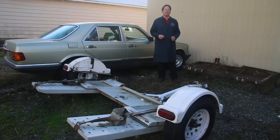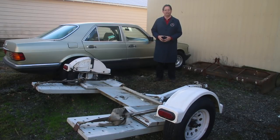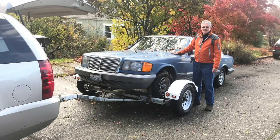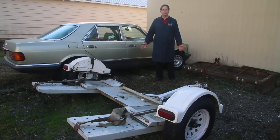Number one — and Mercedes recommends this, you'll actually find it in some of the manuals for these older cars — you are not supposed to tow a Mercedes Benz with an automatic transmission for any great distance at high speed, or you will ruin the transmission because it's not getting proper lubrication. Mercedes publications say you can drive it so many miles under 40 to 45 miles an hour and you'll be okay. If I only have to go five miles or less and don't plan to go over 35 miles an hour, I'll roll the car on the towed dolly with no problem. But I was coming up from Seattle — a two-hour drive at 60 to 65 miles an hour — and that can destroy a transmission.